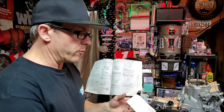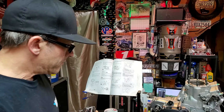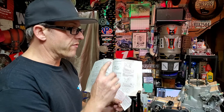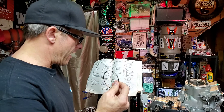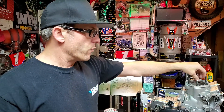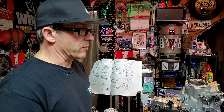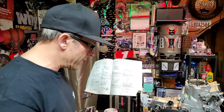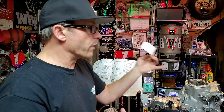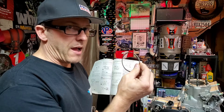When you order a new piston, it'll give you what is recommended. For this particular one, doing the Wiseco piston, it recommends .004 per one inch of bore for your ring gap. I've got a 68.50 millimeter bore — it's an overbore cylinder — which is 2.697 inches. So we would multiply .004 times 2.697, which equals .010 inch of ring gap I should have.